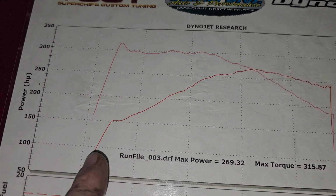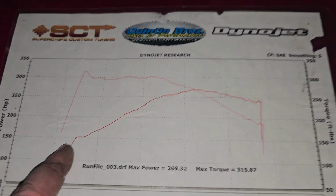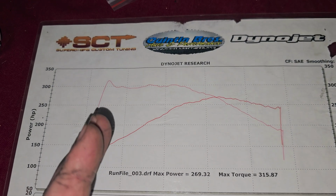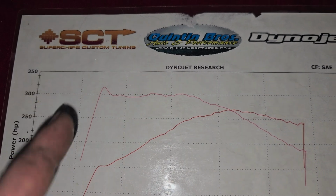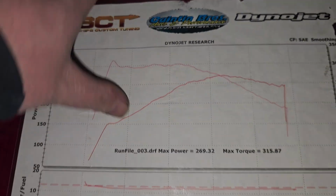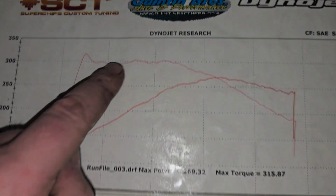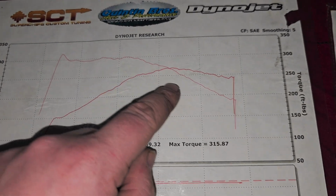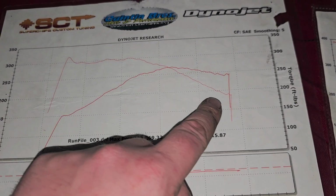And you can see the torque that you produce in the KO3 is really not good for OEM rods because it's so dramatic. It just puts so much stress on the rods. And you can see at about 4,500 the stock turbo drops off, okay? And that's for every KO3 that does that.